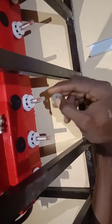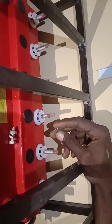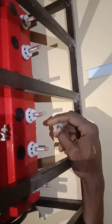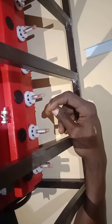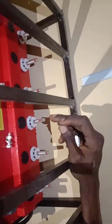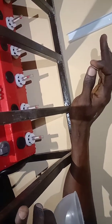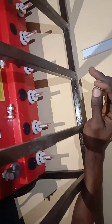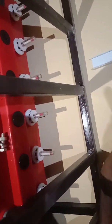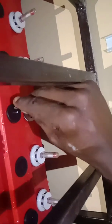The battery has six cells, which is why we have six gauges. Each cell is filled with electrolyte mixed with distilled water. When the water level drops, it is not the electrolyte that drops — some engineers will say to top it up with electrolyte, but that is wrong. The battery was designed by the manufacturer with the required quantity of electrolyte already inside. During the charging and discharging cycle, it is the water content that drops, not the electrolyte.